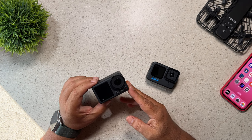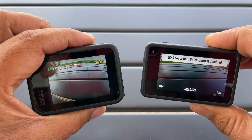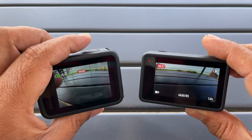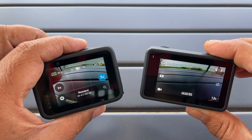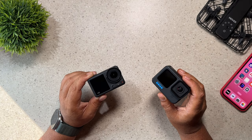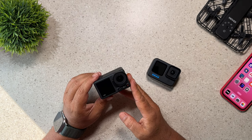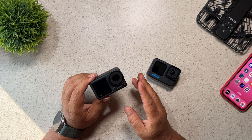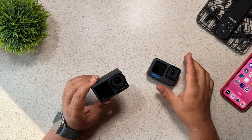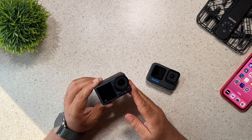The third reason is the DJI Osmo Action 4 does not overheat when recording at 4K 60 frames per second. In an extreme environment like a hot desert perhaps it will, but in everyday filming it will not overheat. Whereas the GoPro Hero 11 Black usually will overheat at 4K 60 around the 27-minute mark. 4K 60 is quite often what I'm filming in, so having a camera that doesn't overheat is very important. Reason number four is just better thermals all the way around — the Action 4 can record a lot longer in higher frame rates like 4K 120 than a GoPro.